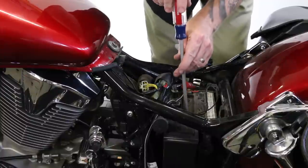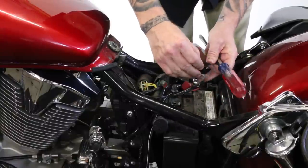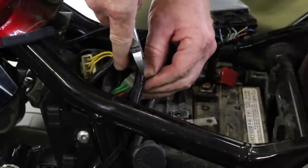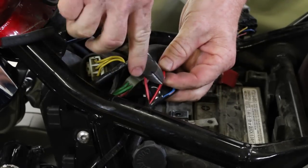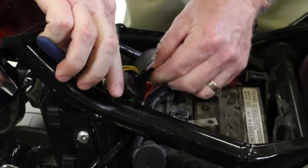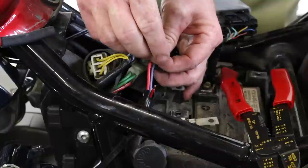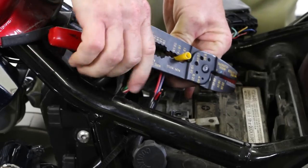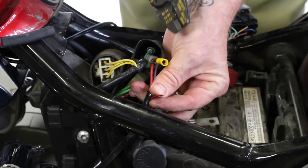Now that we've found our remote wire, Ryan's going to unhook the battery terminals because we're going to clip a wire — God forbid he touches the frame and sends sparks flying. Just for safety, make sure you disconnect your leads from your battery. Ryan is cutting back some of the stock wire loom, just getting it out of the way. Once he gets that back far enough, he will snip the red wire with the black stripe — that was our remote power. He's separating it out and cutting that in half, and we're going to tap into that as our remote wire to turn the stereo on and off. We've got a yellow butt connector — he's going to butt connect one side. Now we've got our positive to the battery, negative to the battery, and then we'll put that remote to where he's butt connecting.